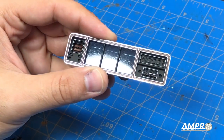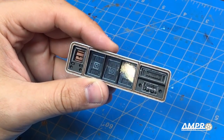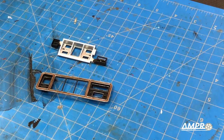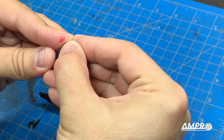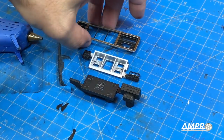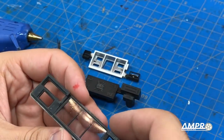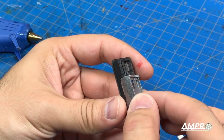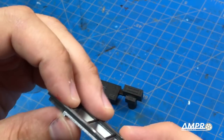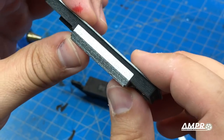That is a mock-up of what we're going to be left with. I'll do a little bit more detailing, but this is coming along nicely. We'll install the instrument cluster. We need to take off this little blue stuff. There it goes. We'll take our bezel, grab our lens, making sure not to get any fingerprints on it. Then we'll get our trim piece here, drop that right in there. And this should hide the glass directly inside because the glass is sitting in a recess.